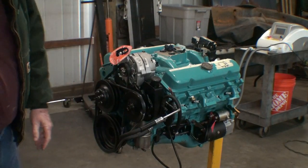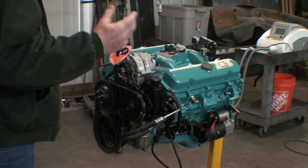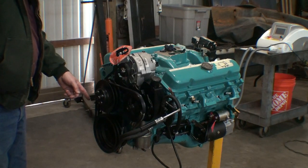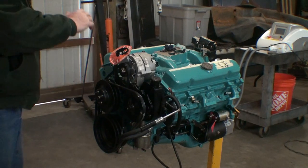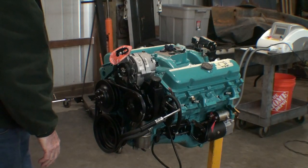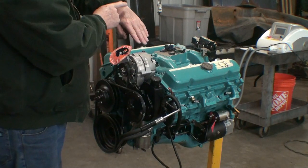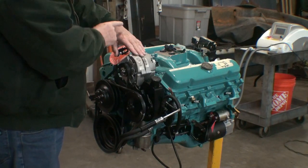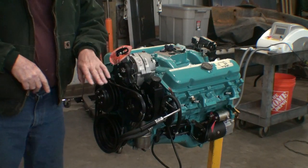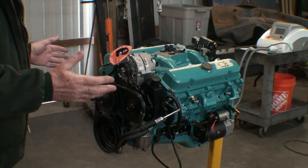If you don't know the rotation and you can't find it in a manual, the first thing is go to YouTube. But if you look at your timing mark indicator on your engine — most everybody has them — it's gonna say five degrees before top dead center, three degrees before TDC, and so on. Mine says 24 before, then goes to zero. If you're looking at the harmonic balancer when it spins, it's going counterclockwise. That's just a hint. The best way is to find out before you start doing anything.